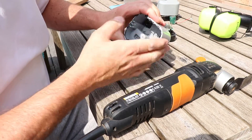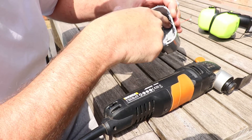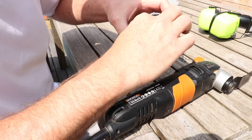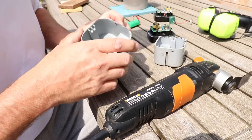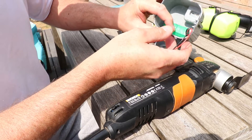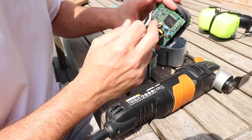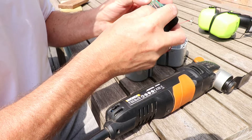I won't bore you with that bit. You just basically need to trim off the plastic battery cover — the black battery cover — and these bits of plastic in the base, and then you'll be left with something open like this. Then the new battery will sit in there, and I'll probably solder onto the back of the board here, as the terminals are looking a bit dirty.